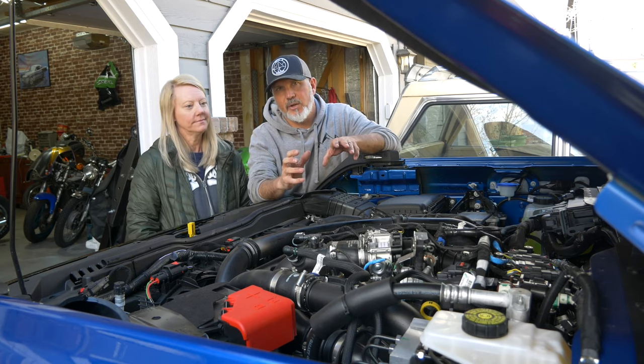Tip four: only put six quarts of oil in your 2.7 before you start it up and check it, because it says it holds 6.6 quarts. We put six in to test it and after running the motor it came out pretty good. You may need all six and a half quarts in yours — we may add more after driving it a while — but don't overfill the crankcase. Go six, check it, then add as needed. That's a wrap for My.3 Garage. This is the first episode in the maintenance series for your Bronco. Please like, subscribe, and share, and check out our other Bronco videos in the end screen.